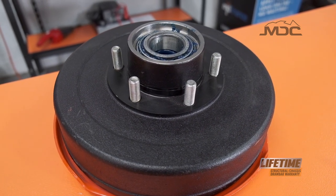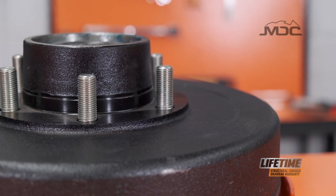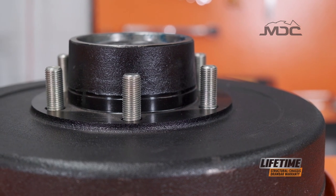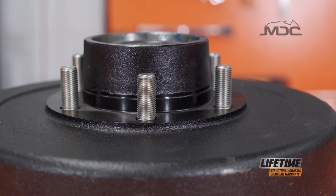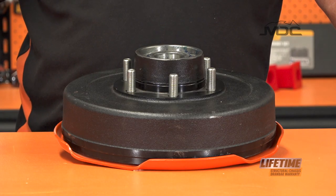You can run much higher torque settings without worrying about stripping the thread or breaking the bolt. It allows us to then go to the maximum torque setting for the aluminium wheel. Aluminium wheel manufacturers such as Alcoa will have a maximum torque setting allowable for wheels manufactured from their aluminium.